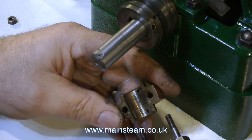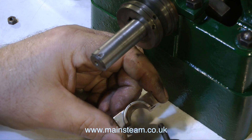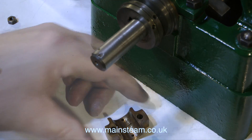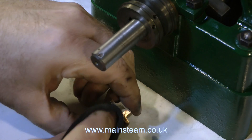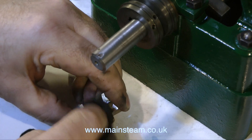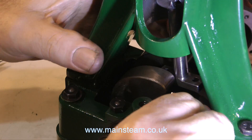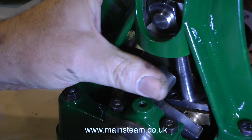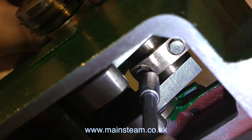It's time now to look at refitting the big end. These are the big end brasses. They only fit one way around, so you can't really get it mixed up. Someone's put a mark on one of them, but oddly enough there isn't a mark on the other one. So first of all I clean the parts, then refit them to the engine, once again using lots of oil. This is quite a fiddly job, and you must be careful not to trap your fingers.